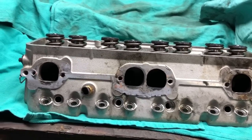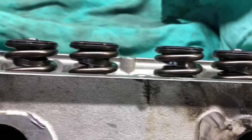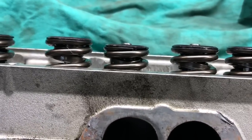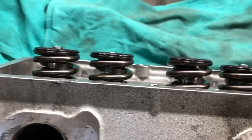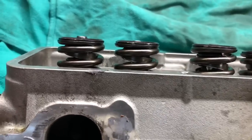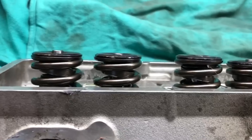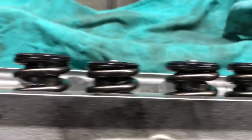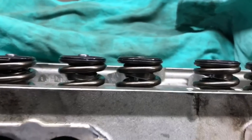Looking at this video, one of these is not like the other — can you tell which one it is? Coming through and looking at installed heights, everything looks good... whoa, wait a minute. That one is the damaged one for sure. All the other ones look pretty good, and you can see the different heights on how much valve stem is sticking up. These valve stems — the locks are down a little bit further than these over here, so these get really close to the rocker, but it's just the way that valve is designed. I could put a lash cap on it.